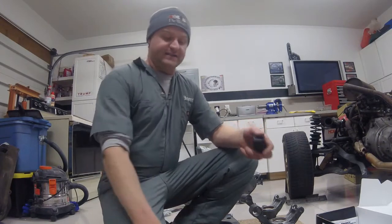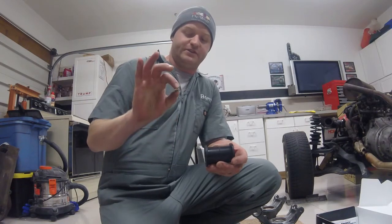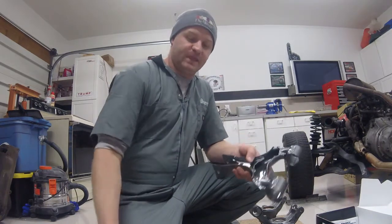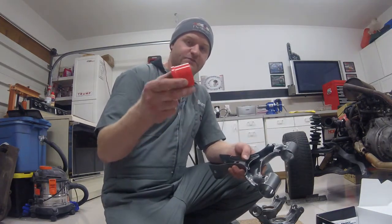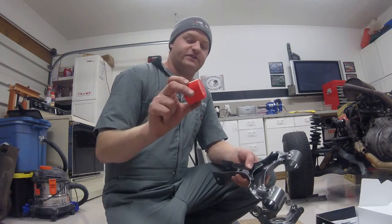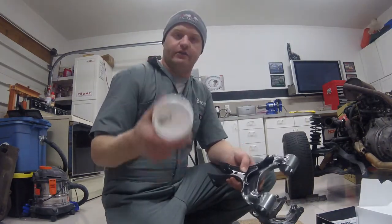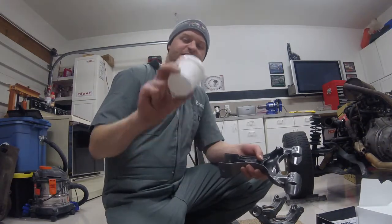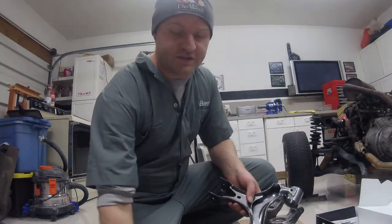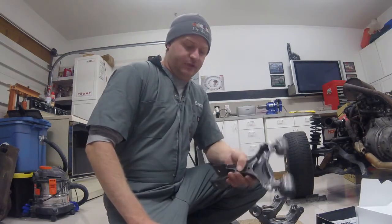So as I install these energy suspension bushings, I also will be doing the Zerk fitting modification. I personally have never had the energy suspension bushings squeak on me, as long as you use plenty of their pre-lube. This is what they supply you with in the master kit, and it generally is not enough to liberally grease all the bushings. I recommend getting another tub off Amazon or wherever you buy the bushings, about $15 I think for an extra tub, and it's quite a bit bigger than what they supply you with. Definitely invest in another tub as you really want to soak these things.